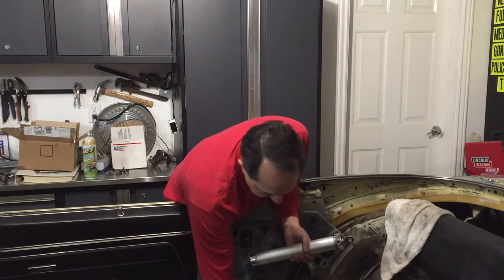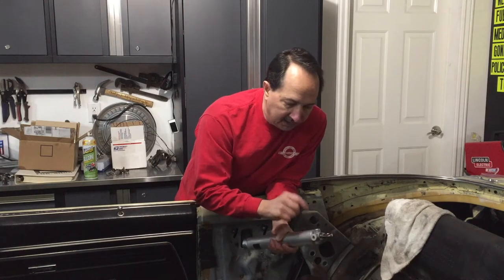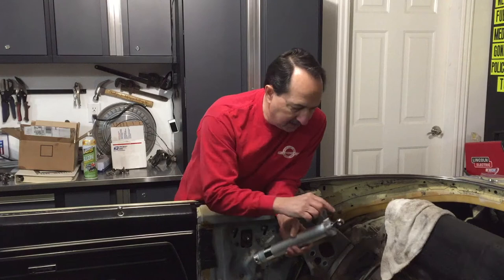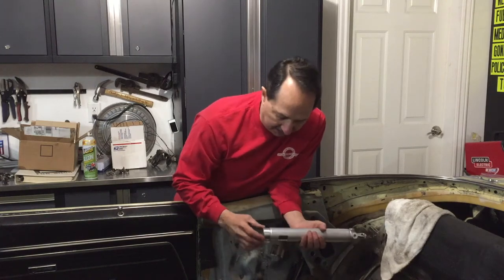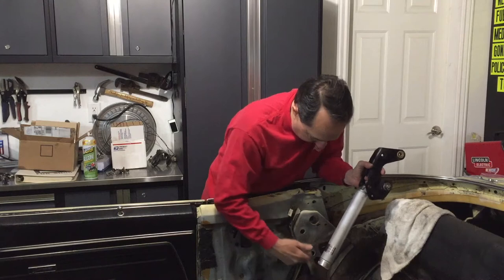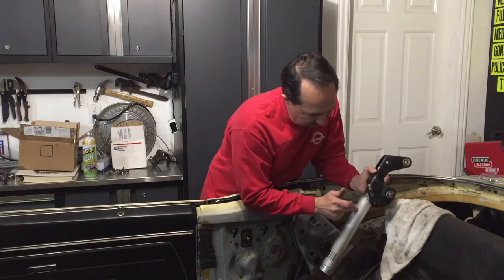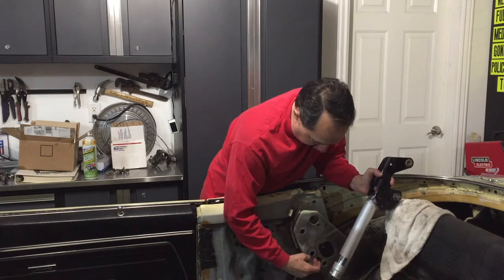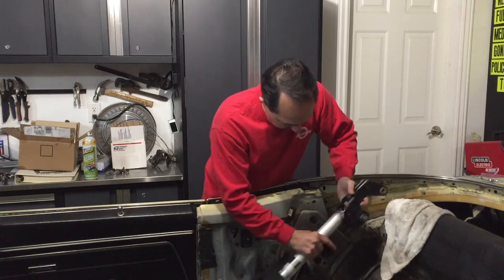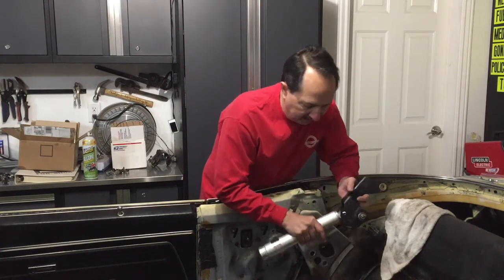One thing you can notice on these new replacement parts: they do have the plastic bushings on each end. Some of them don't, so you have to make sure to keep your original ones. They also have a little o-ring inside each one of these ends to seal it off. These came with an extra set of o-rings, so if you damage or lose one, you do have extras. One of the reasons I had to take all this apart was to get the alignment perfect so I could tighten up these bolts — the bolt was tight against the framework so I had to take everything off and move it to get that nut out.